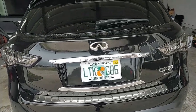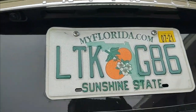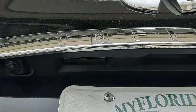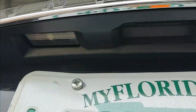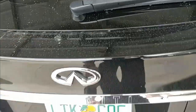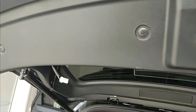While we're at it, let's go ahead and change the LED lights for the tag lights and the reverse lights. I think it just looks a lot better on the outside — it makes it look a little sleeker at nighttime and more expensive. On the first gens, you just take out two screws on each side and swap them with the T10 LED style bulbs. On the second gens, however, that is a lot more difficult coming from the outside because they have this plastic surround with a bunch of clips. The easier way is to come from the back — the back door entrance — and it is super simple.